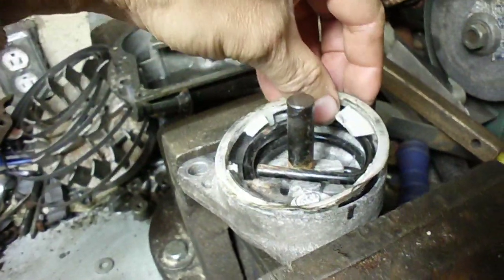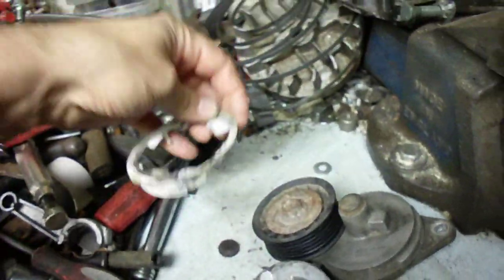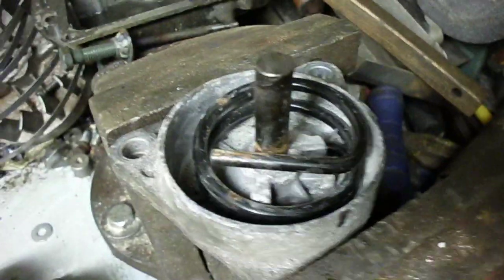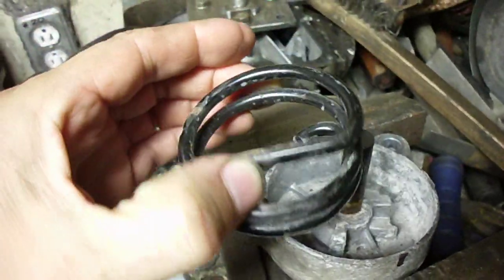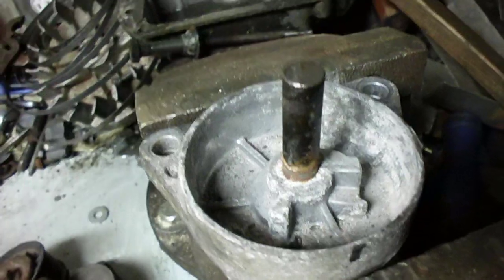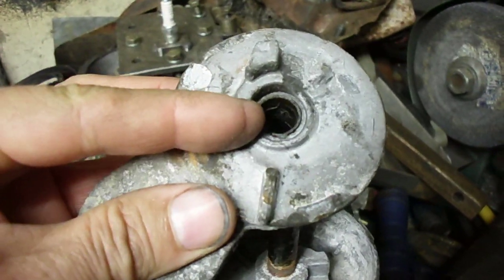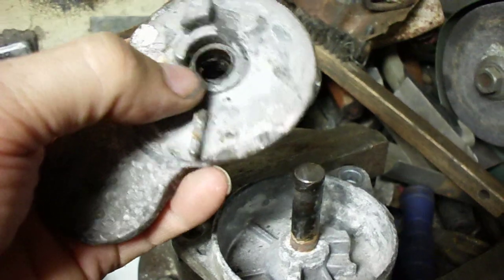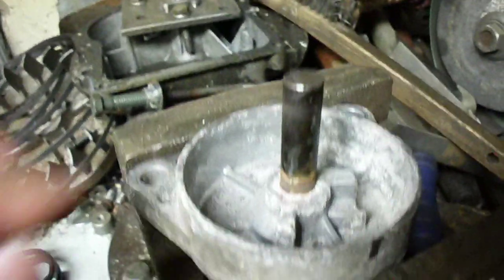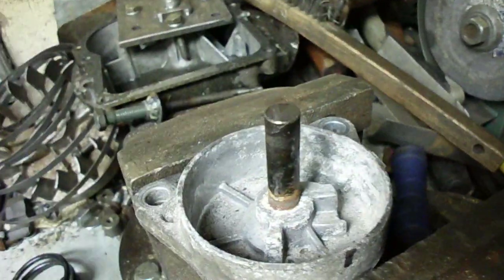There's a little plastic part with the pin in it — just like a plastic shield. Inside it you have a steel shaft and a spring. As you can see, there's nothing wrong with the spring — it's not rusted or anything. The problem is with the steel shaft and the part that holds the roller, which has a plastic bushing in it. So it's not metal-on-metal seizing — it's plastic against steel. The steel swells up from rusting and seizes the shaft so it doesn't want to rotate.